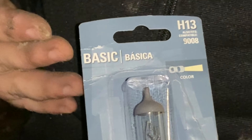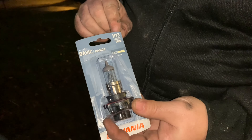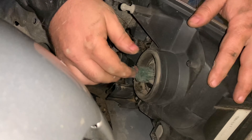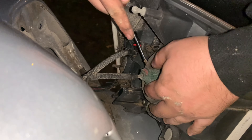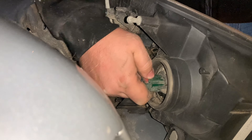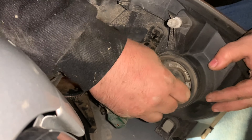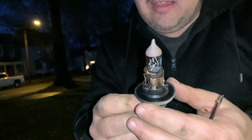The kind of bulb you want to use - I've got a regular generic bulb, it's an H13 9008. It's going to be this wiring harness. It has a little red tab that pushes back evenly, and once you push the red tab back, push down and pull out. You can see there are two little ears and you're going to want to twist counterclockwise to remove it.